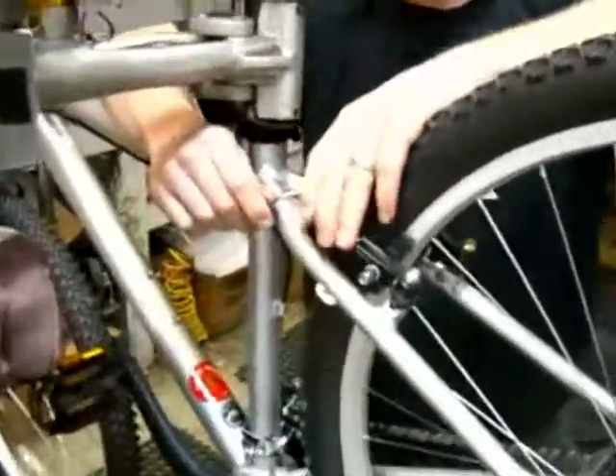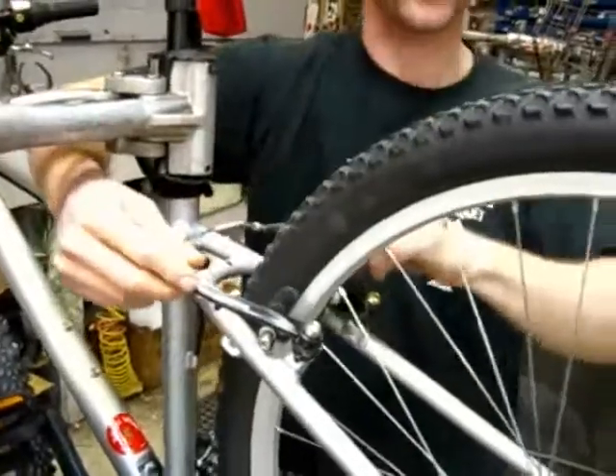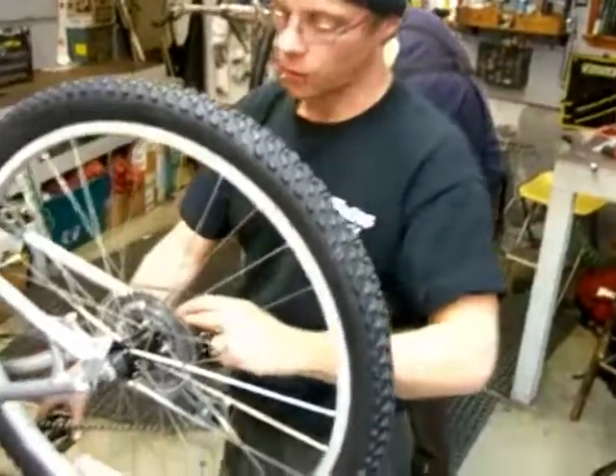What you do there is hold the brake together in your hands and wiggle the cable out of there, and that opens the brake. Usually if it's a rear wheel, it's the one that's a little bit harder. You want to make sure that the gears are shifted all the way to the bottom, to the hardest gear in the back — it makes it the easiest getting the wheel off.